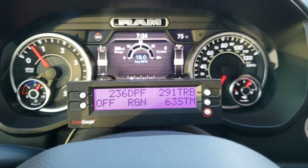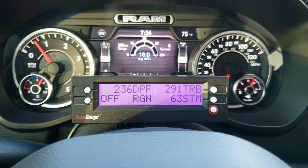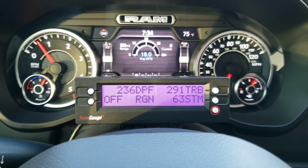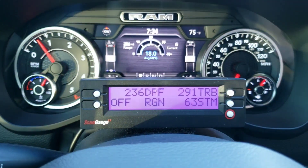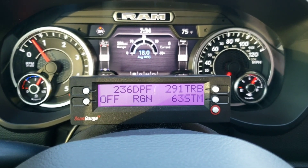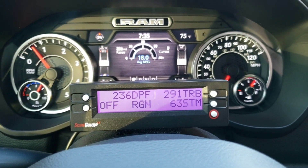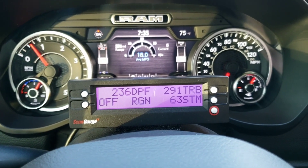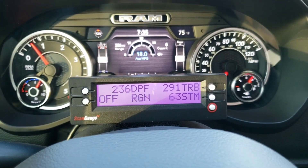That's kind of interesting because I guess I didn't understand how it worked. I was under the impression that as long as you're driving the truck — actively cruising down the road — it will naturally burn off some of that soot. But that's not the case. I've found that you really have to get the diesel particulate filter temperature up in the 600s, 700s, 800s — you've got to get it way up there, several hundred degrees, before it will naturally start to clean the filter. The only time I've seen that happen is when I'm out on the interstate at 70 miles per hour, or when I'm towing a pretty sizable load. You really have to be working this engine to get it to do that.